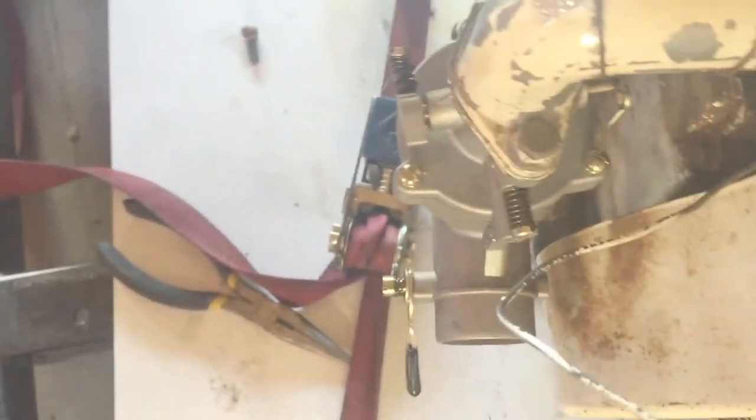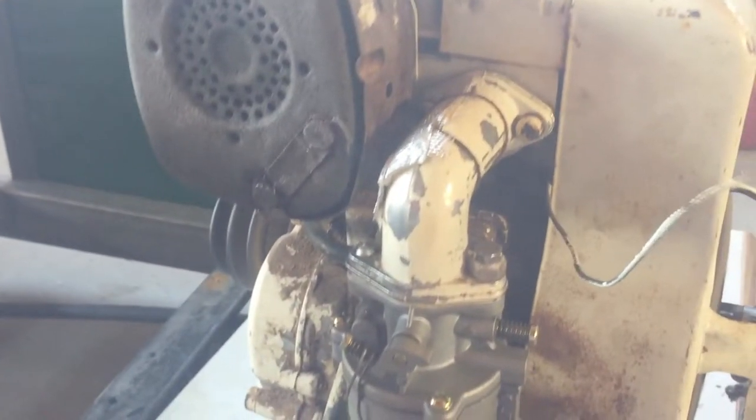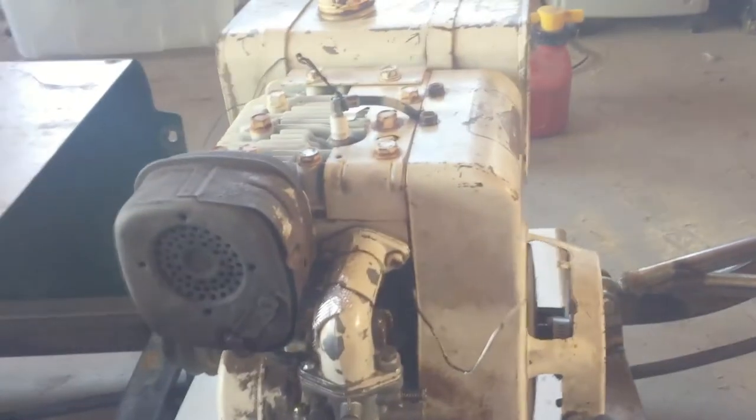We got to turn the fuel on - that would have been my mistake. The fuel is actually really cool, you just twist this little knob a few times. She should have gas in her. I'll actually try to hold the camera and start it. Let's try to get the choke just cracked open. I'm going to pull it just enough to prime some gas into it. First pull - ready? One, two... Yeah! It runs good!